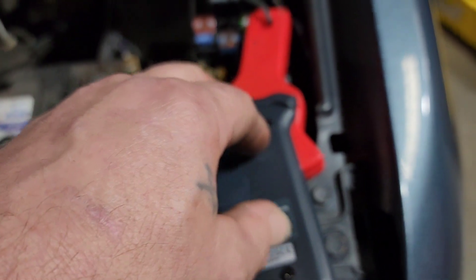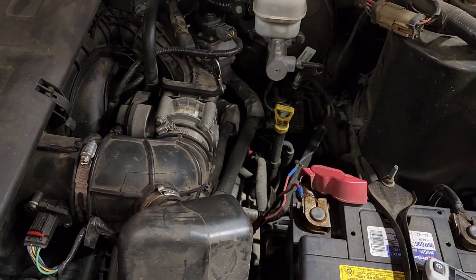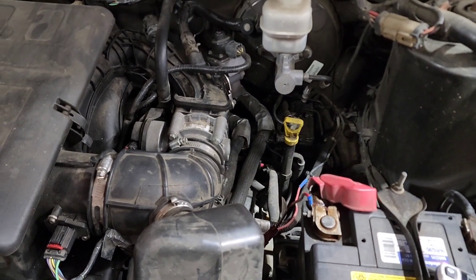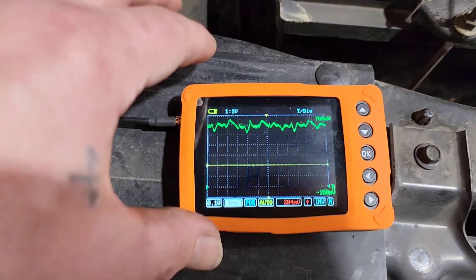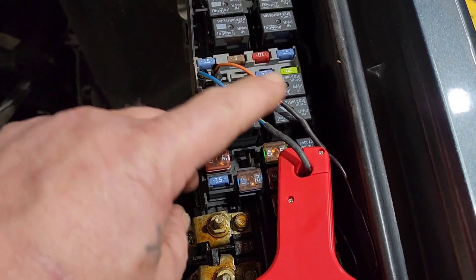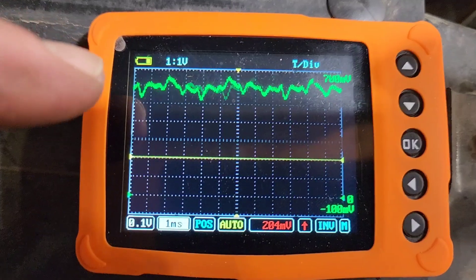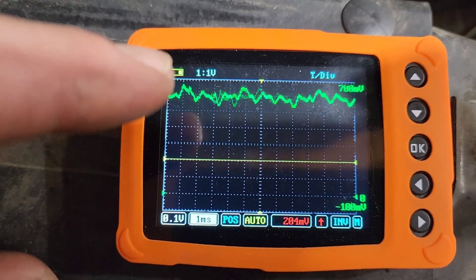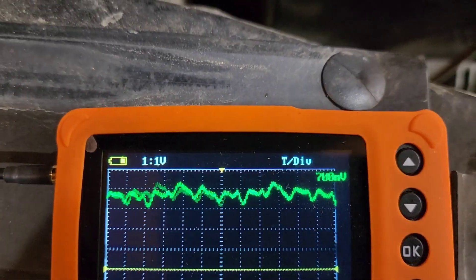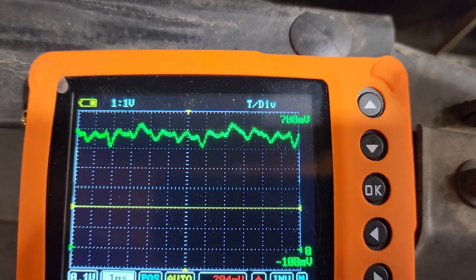I was able to get the low amp probe in use for the video. I got this three-liter Ford Escape that came in as a crank no start — scanned it and had a fuel pump code. So I got the Uscope here with my low amp probe. What I did was put a little jumper loop in here for the fuel pump fuse, and I'm sitting here scoping the fuel pump. Normally the fuel pump humps should be pretty close to the same — these are not. This is just one more use of the Uscope and just how simple it is to use.